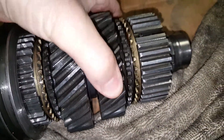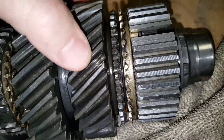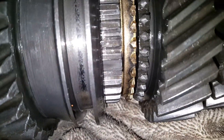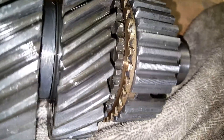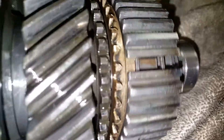This is third gear. It doesn't move. Those engagement teeth don't look too bad. But these don't look too good. Now that hub — round it off on the front edge, all the way around. Looks like a little bit of heat generated right there for some reason.